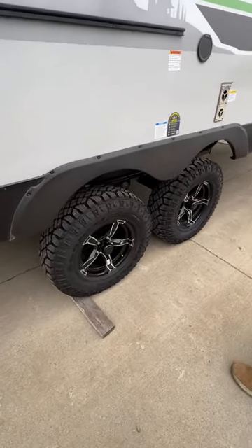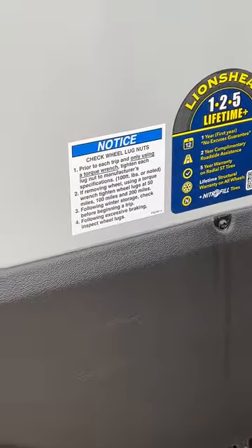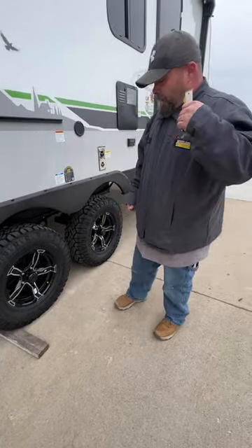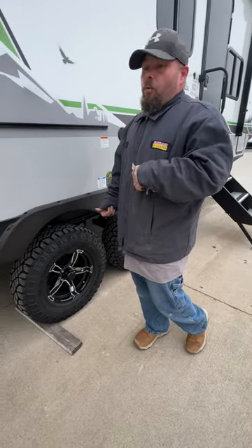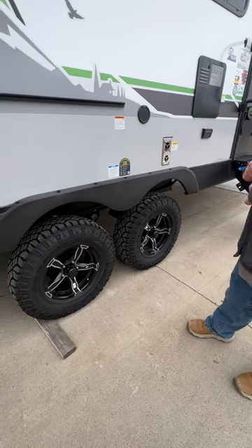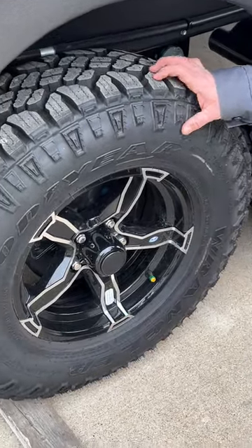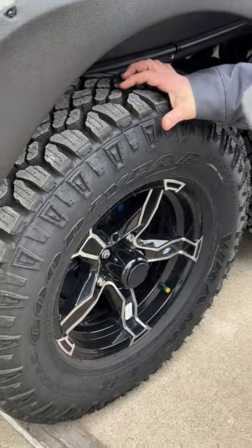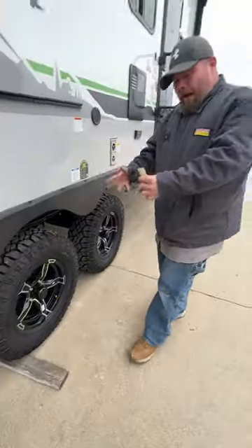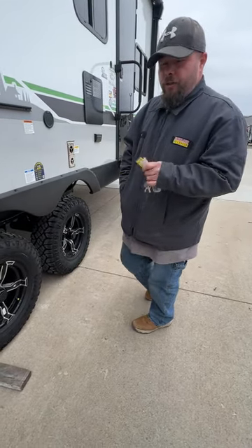So on the tires — you always want to make sure that the lug nuts get torqued at 50, 100, and 200 miles. Our sticker here tells us we are torquing those to 100 foot-pounds. I like to say when you leave the campground, your first stop is usually the gas station — while you're refueling you can check the lug nuts, knocking out two birds with one stone. You also want to keep the tires topped off to max PSI — these are good Goodyear Wranglers at 50 PSI. These caps on the valves tell us there's a tire monitoring system — sensors inside the tires. If you ever get the tires replaced, let them know there are sensors in there so they don't get damaged.